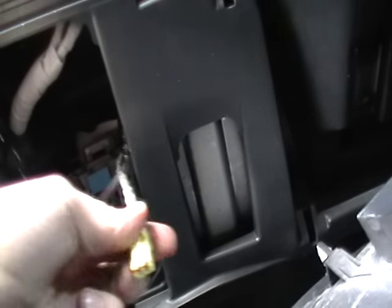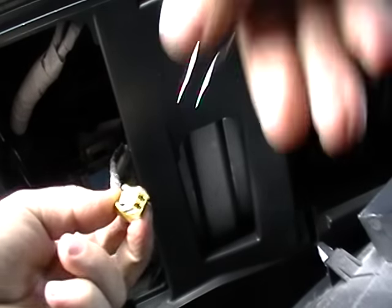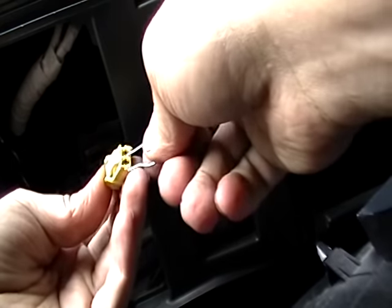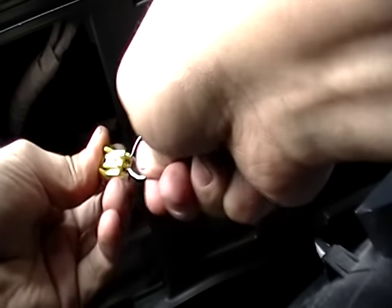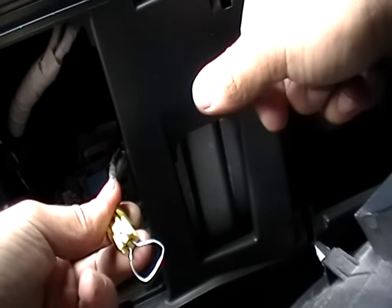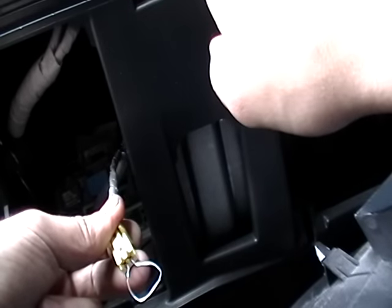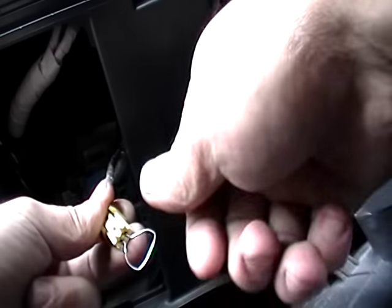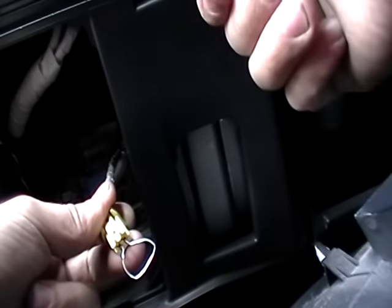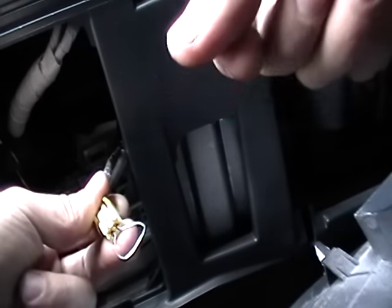The reset procedure is pretty simple. Ignition on, meaning you have to plug this in — so we plug this in, in this end connector right here. It's a pretty good connection. Turn the ignition on. As soon as the ignition is on, the airbag light will come on on the dashboard. After six seconds, it'll come off. As soon as it comes off, you disconnect it. As soon as it comes back on, you connect it. As soon as it comes back off, you disconnect it.